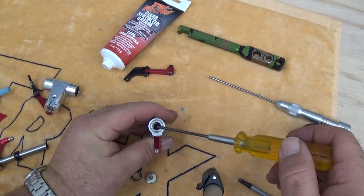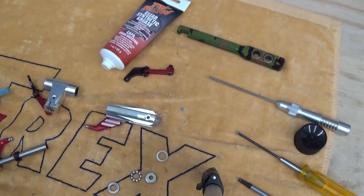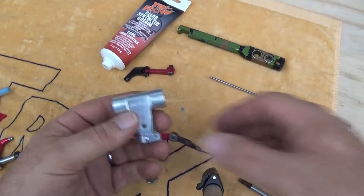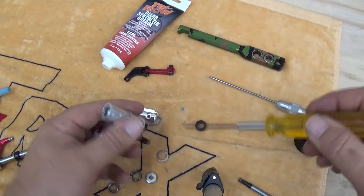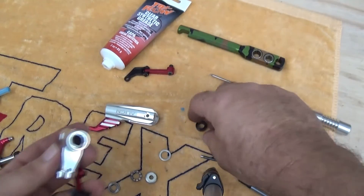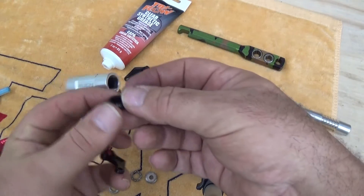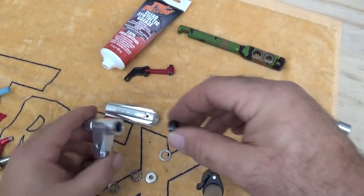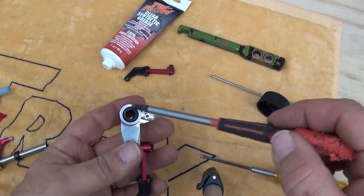The grip itself is back together. Right now the inner radial bearing is in place and the outer radial bearing is in place. The rest of the bearing assembly is lying here on the workbench to see how it goes back together. First thing I'm going to do is take a look at the rotor head itself — I currently have one of the swash driver arms off for clarity. Inside the grip or center here we've got a few different pieces. Through the center is a plastic collar, a plastic sleeve — this just reduces friction. On the outer sides of the main rotor head you have the damper assemblies. These have a shoulder to them — a square on one end and rounded off on the other. The square side goes to the intersection of the main rotor assembly, so the little bit of bevel is right here on the outside.